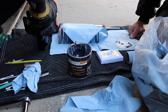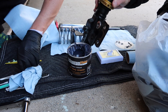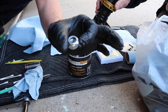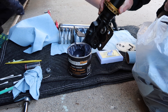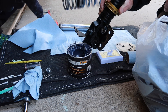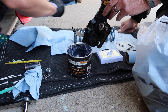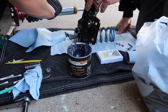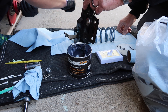On a higher quality shock this isn't an issue, but unfortunately it is on this one. There's a 19 millimeter on the bottom you can access after you take off the adjuster, which just takes a 2 millimeter allen. Pop this off — it's standard threads, but the strut itself threads in reverse, so keep that in mind when you take this apart. Just make sure you take the tension off your springs. Put a thin coat of grease — I was a little more liberal than you need to be, but honestly I don't want to find out the hard way again. Taking the struts out can be done with one person but it's a little easier with two.